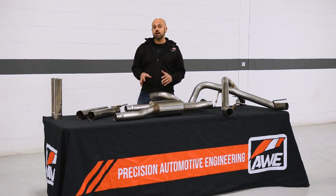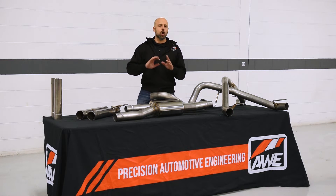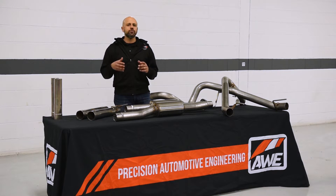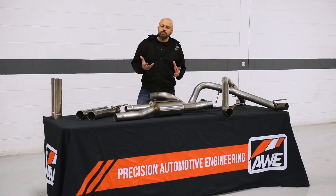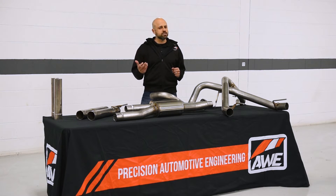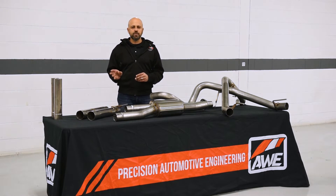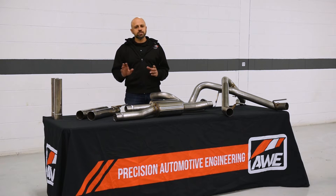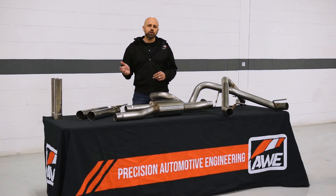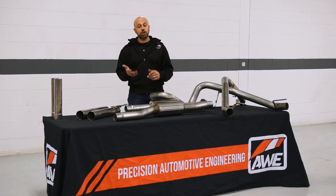So while I have you, let's talk a little bit about packing material and AWE's break-in periods. We recommend a break-in period on all of our exhausts. Typical packing material — not AWE's — breaks apart due to exhaust pulses, kind of getting pummeled over and over inside your resonator. AWE's packing material is a continuous strand fiber to resist breakdown — it's designed for durability. Since we use the good stuff, it's going to take about 800 to 1,000 miles to break in. In layman's terms, harshness reduces and the system tone smooths out, giving you that AWE tone after break-in.